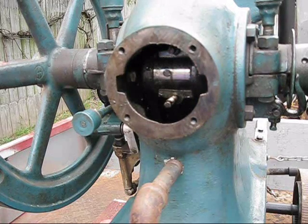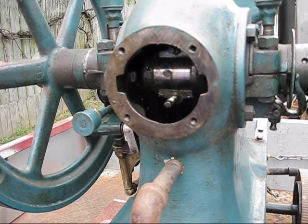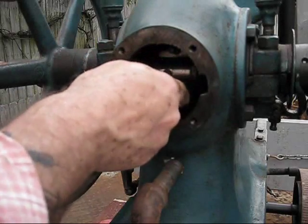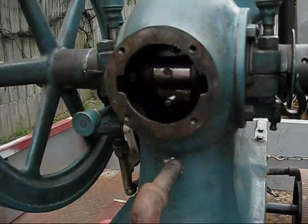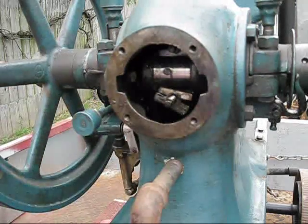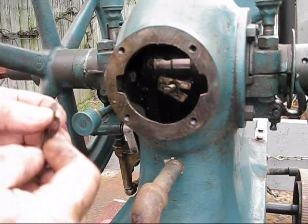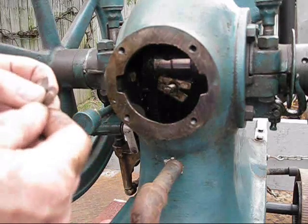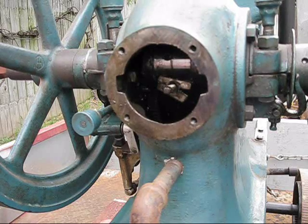So what we've got to do is take a couple of shims out of here. Sometimes the last owner would have taken all of those little skinny ones out. I believe in this case we're lucky that there are some thin shims in there, best I can see. This one came out — I'll put a mic on it and see what it is, but I'm going to estimate that it's somewhere around six thousandths.